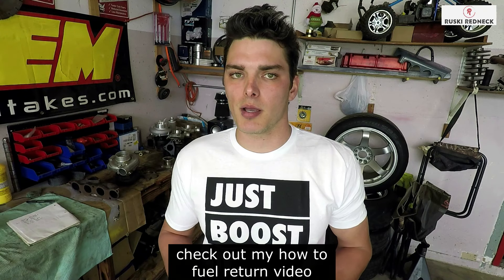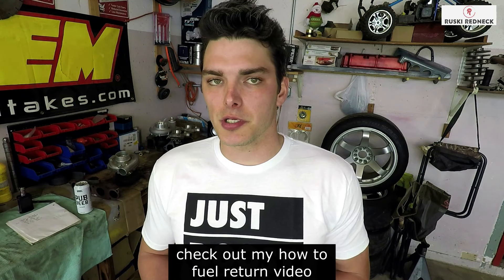A fuel pump will run you about $200. You can get a universal fuel pressure regulator and return kit for around $200 to $300, which includes your fittings and hoses. You're obviously going to need an aftermarket fuel rail, which runs around $150 to $200 — I bought the Hybrid Racing one for $200. If you plan on running over 10 pounds of boost you're going to need the four-bar MAP sensor, which is about $90. A universal oil feed kit runs $20 to $50 — I'd spend a little more since I had one rupture on me. The oil drain is another $20 to $30.